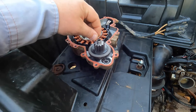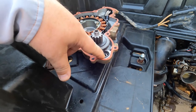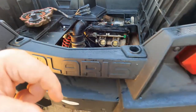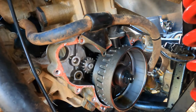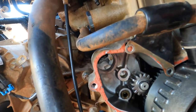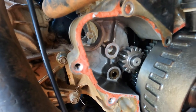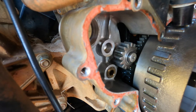So anyway, this system here, you've got a series of gears. Your starter pushes into there. It connects to this gear, which is turning this bigger gear here. And let me come down here on the side where it mounts up. So this all mounts down here, and here's where all that gear mechanism is. So that hole there that you see going through, that's where the starter comes in and touches these other gears. And then you've got that bigger gear right there. It spins that, which then spins another gear that you can see down there behind the flywheel.